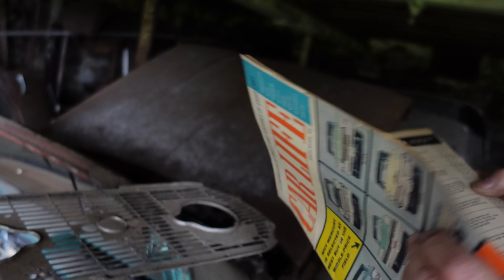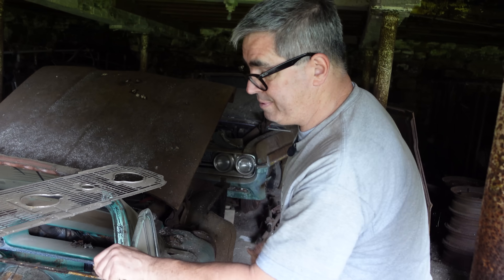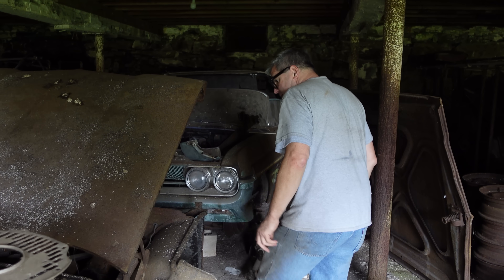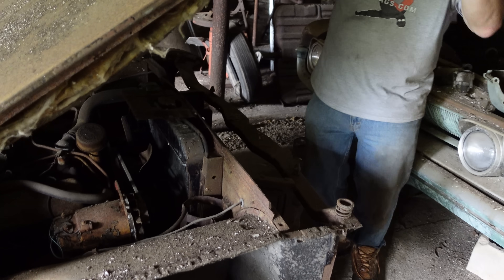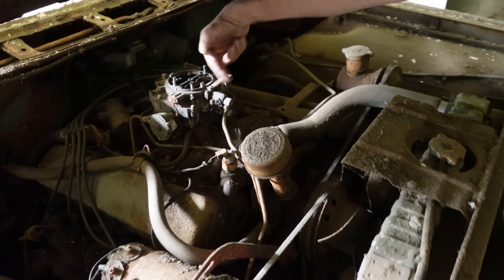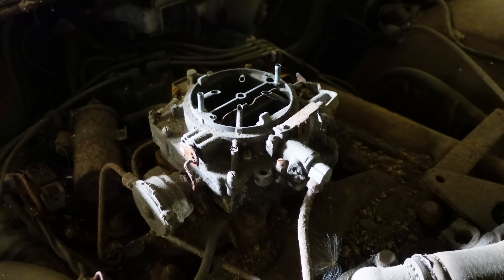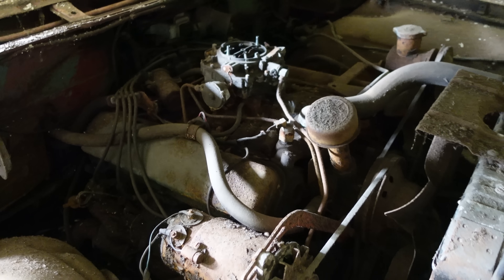The convertible is always the strangest and rarest. 1959 was the year the 371 grew to 394 cubic inches. Let's take a peek and see if it's still here — yeah, there it is. This is the first year of the 394 with a four-barrel carburetor. I don't think the J2 triple carbs came into the 394 era; I think that was 1957-58 only. With the 394 four-barrel, you're looking at something like 320 horsepower and 400-plus foot-pounds of torque.